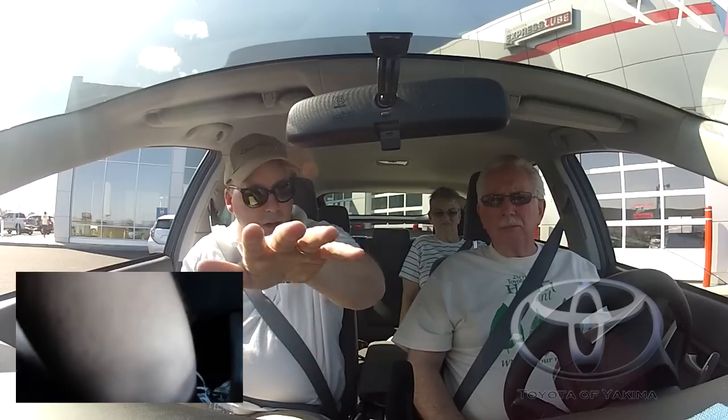We're going to use no gas to about 16 miles an hour, and then at about 16 we're going to fire off the engine. We're going to climb up that hill, get up to 25, 30, whatever, and then we're going to get the engine to shut down. We're going to coast down the back side, and I'm going to show you how to force a glide with the engine off.